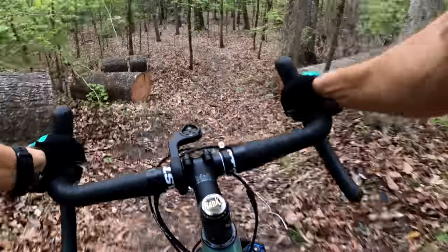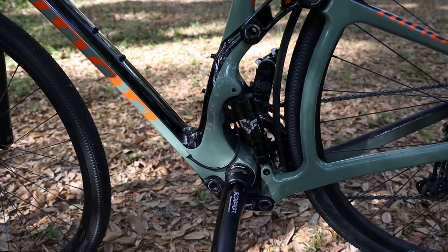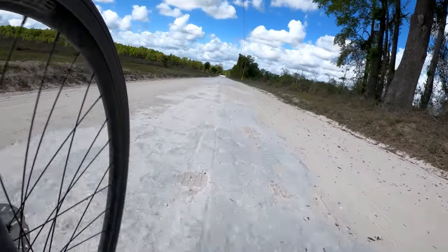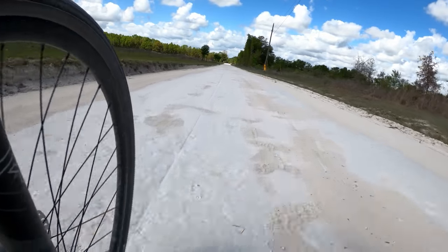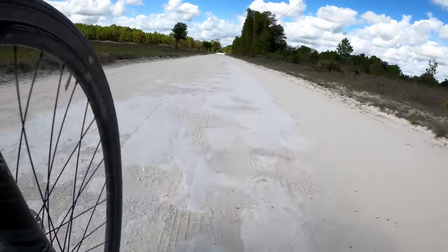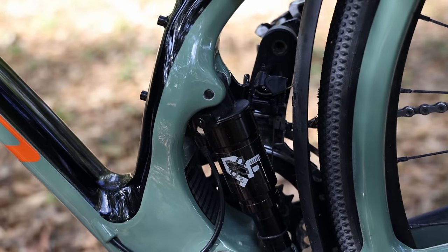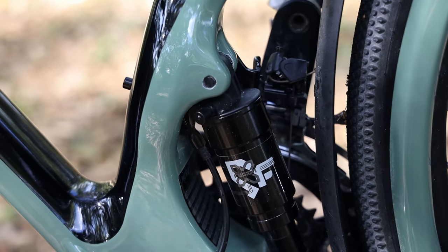I want to talk about how the suspension on this bike is tuned, because honestly it's what makes this bike different than any other suspension bike I've ridden, including all the mountain bikes. This bike is tuned to absorb lots of small bumps. Because the rear suspension only has 50 millimeters of travel, you're limited to the type of bumps you can hit — you can't go flying down a trail with 4-inch roots or rocks. Niner have tuned this suspension to be extremely linear, so the bike is designed to blow through the travel pretty easily, which is what makes it so comfortable on gravel roads where you're hitting so many small bumps consecutively.